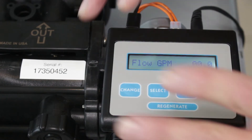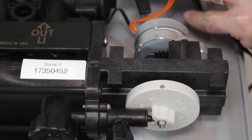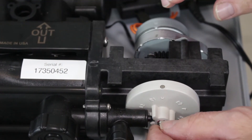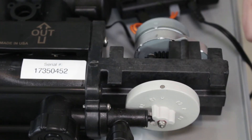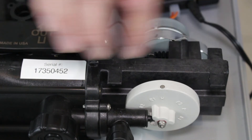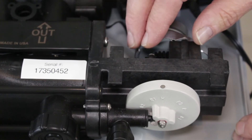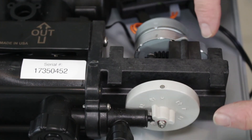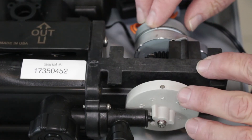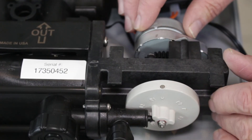If none of those were an issue, we need to go a little bit deeper. We can remove the controller and have a look over here. The magnetic disc may have been causing the problem — make sure that it's tight and sitting on here properly. Or the problem could be something stuck inside the valve body itself, so the valve would need to be disassembled and checked out. If you find that the motor is running but it's running and then click, run, click, run, click — that tells you there's something wrong with the valve assembly and it needs to be disassembled, checked out, and if necessary replaced.